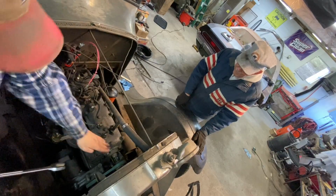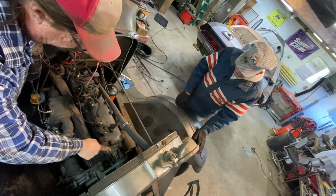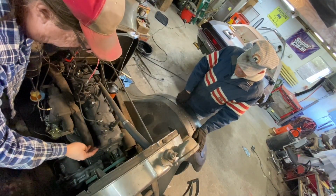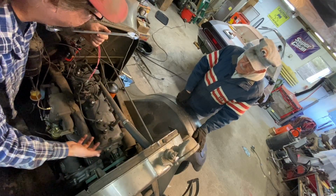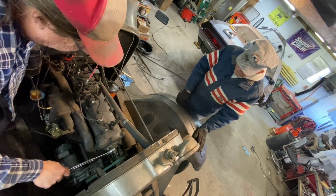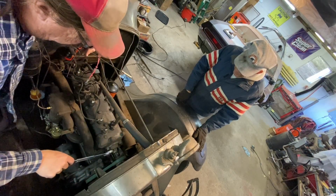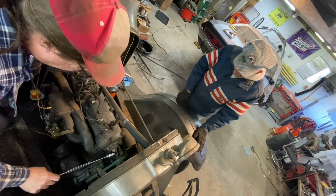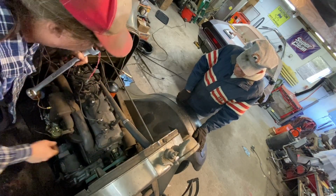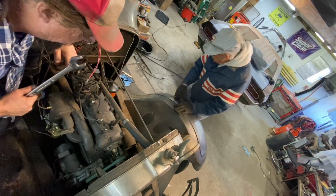Well, the tool that I was thinking of won't slip over that because it doesn't have an open end, but this 1.25 wrench does. The thing we have to be careful of is you don't want to do too much. So we'll probably give it maybe a quarter turn, a little more than, and then start it up and see if it's still leaking, because you can over tighten it and then ruin the packing. And a lot of times it doesn't take much. So we'll see. That's quite a bit right there. I think we'll leave it at that and see how it is. Bearing feels good and tight in the pump, so I don't hear or see anything there. Let's get some towels and we'll dab that out, dry it out, and we'll fire it up and see what happens.